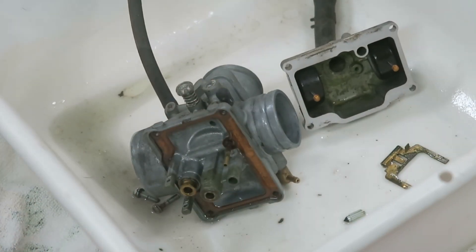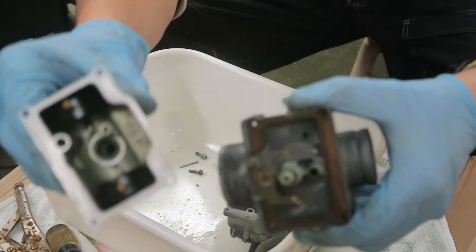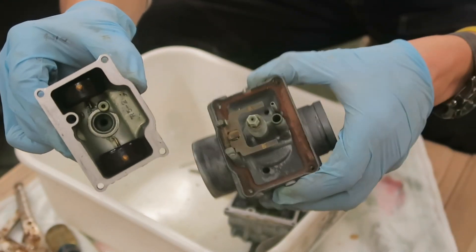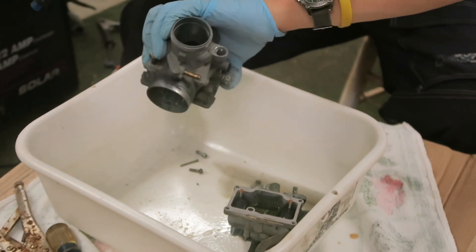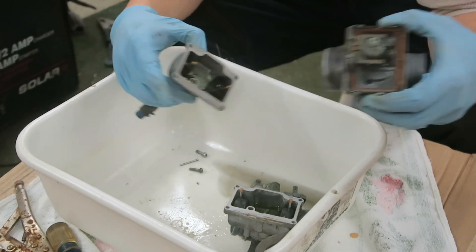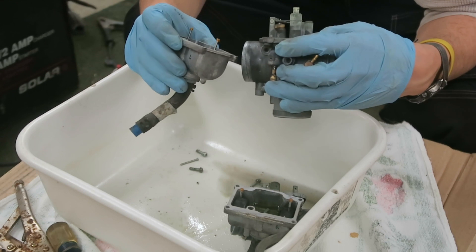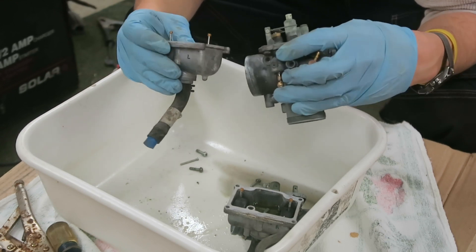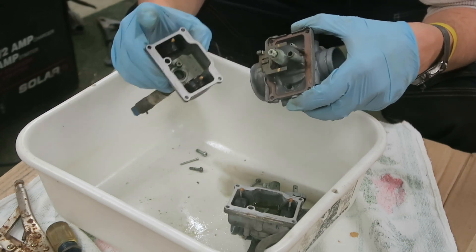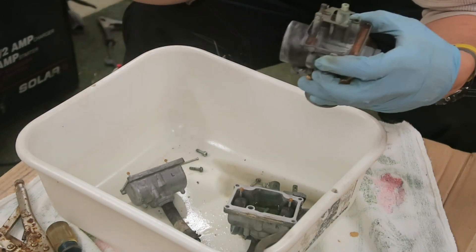That smells funky. I just went ahead and took apart the other carb — this one's not nearly as bad as the other one. You can still see some green slime underneath there, but not nearly as bad. Some water came out, probably still a little bit in there. I'm gonna soak this one, spray it and let it soak. I got this one soaking with all the components inside the bowl over there. I'll let that sit for a bit, then take a rag and clean the rest of it.